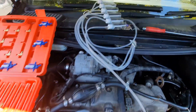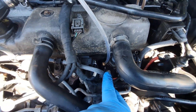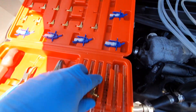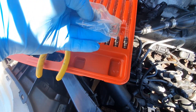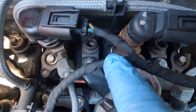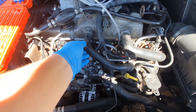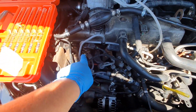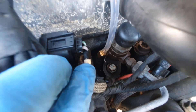I've got the leak-off test kit here with everything out ready to go. I've already got one connector tapped in. I checked which connectors I need — it's number two, these little brass bits. I've also got some spare clips in case any of them pop off because they're very fiddly. I've got a few little pliers to help as well. First I'm going to disconnect these two hoses to give myself a bit more room.